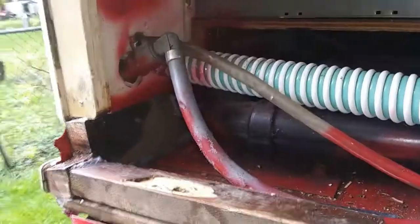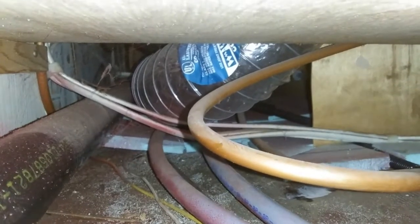This is the reframing of this corner — we had termites and rot where the roof in the cab-over ran into the floor of the cab-over, and this ran down into the wall and rotted it out. I'm also beefing up the insulation in this camper. Normally these side wings and side uprights are not insulated, so I'm adding insulation. That white powder stuff you see is actually termite feces.